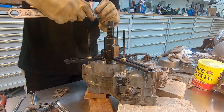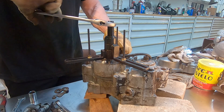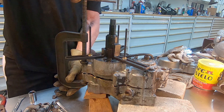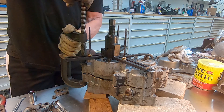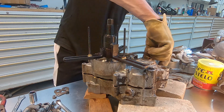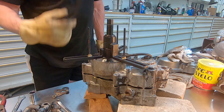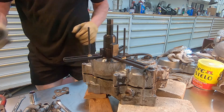Let's see if we can get these things to split now that we've got that sleeve out. I have a feeling it's going to go nice and smooth now. Feels like it's coming apart even in the back — we're about to pop some case halves. I like to put these clamps on as limiters so that these things can't get too far out of whack. What that probably was, was the dowel pin holding that — probably a seized up dowel pin. If you put a little leverage on this side you can limit how much this part is going up and make the back end basically have to take some of the tension. That seemed to work on its own without the case splitter having to be turned.